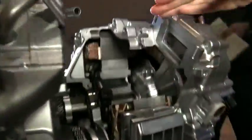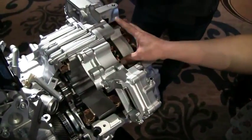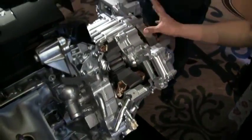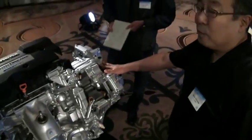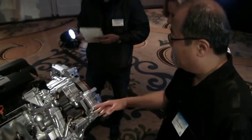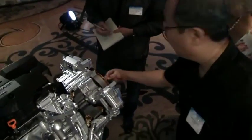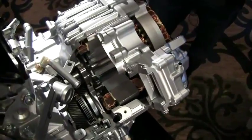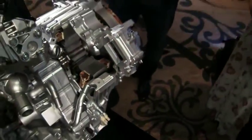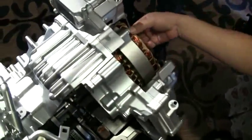You can see running from the engine through that shaft in there, that leads out here to the generator motor. The energy from the engine is turned into electrical energy by this generator motor, and then that energy is sent to the motor here, which is the drive motor. For both of these motors, we worked really hard in making them high efficient through the way we coil the wires and the way we position the magnets. In this small packaging, we were able to get a lot of output and torque from those motors — even just the way you coil the wire makes a difference in efficiency.